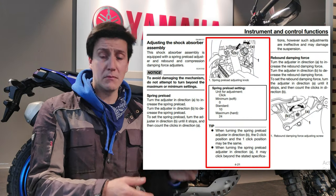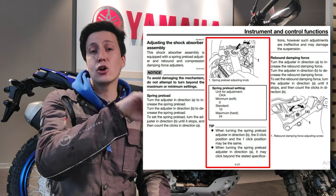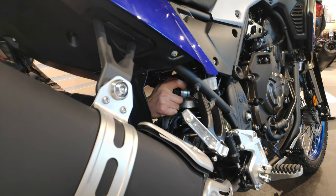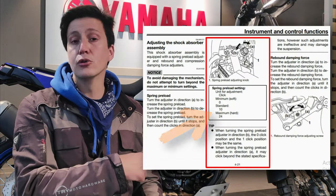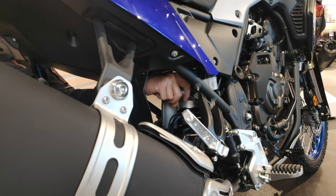Step one is to make sure your suspension is tuned to the factory settings. According to the owner's manual — there's a link in the description — you should first turn the preload all the way anti-clockwise to set it to zero. The manual is explicit about not forcing the knob beyond its limits — when you feel resistance, you've hit the bottom or top. There are 24 total clicks on the preload adjustment, and factory settings are at 10, so let's go 10 clicks to the right.